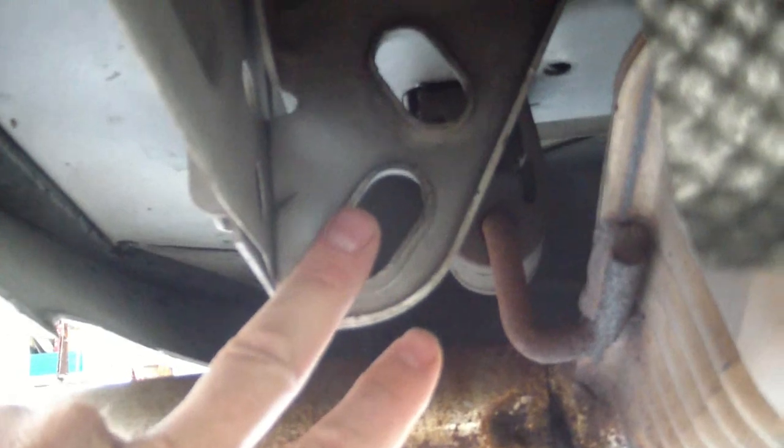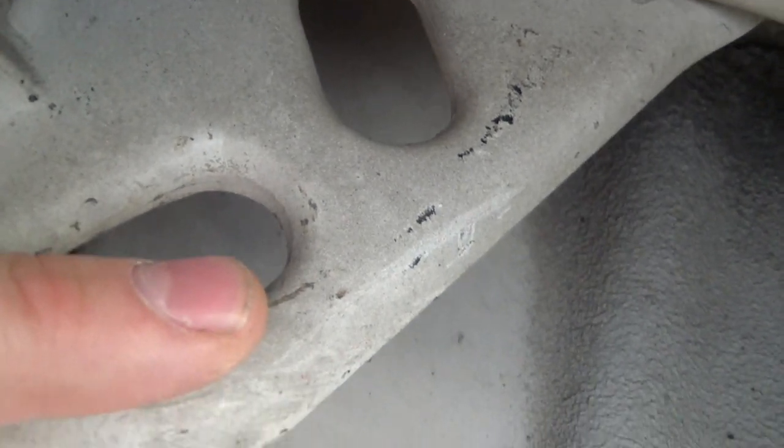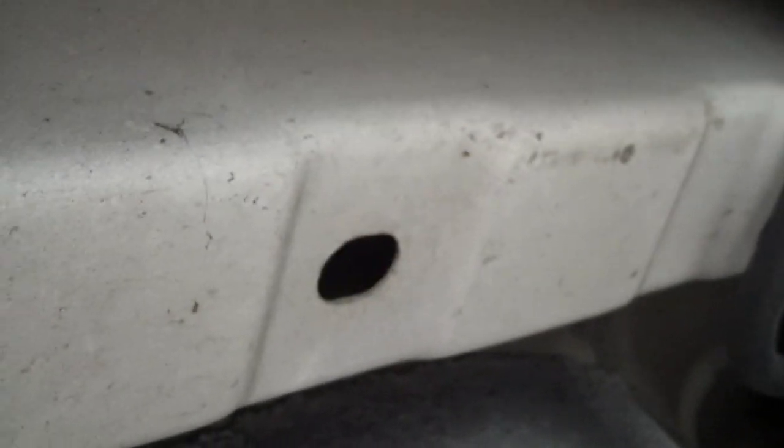The car has these things called tie-down hooks. I'm right under the rear bumper here. We're going to put two plates on either side of this and then put bolts through there to hold the hitch on. That's on the muffler side, and then on the other side there's another set of tie-down hooks that you'll put the bolts through to hold the trailer hitch on. And then there's one bolt up there.